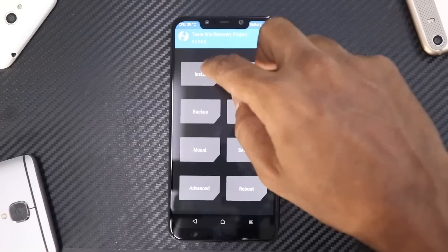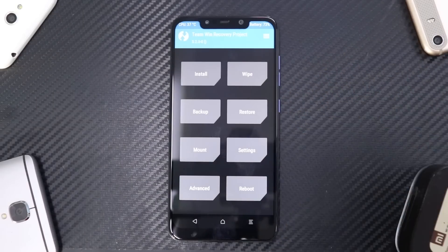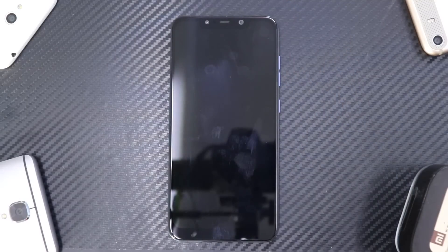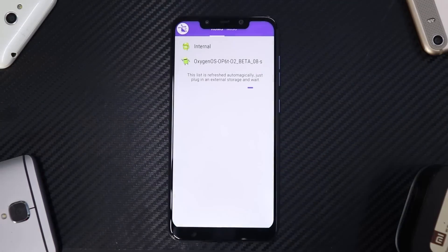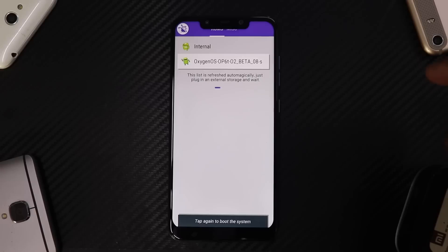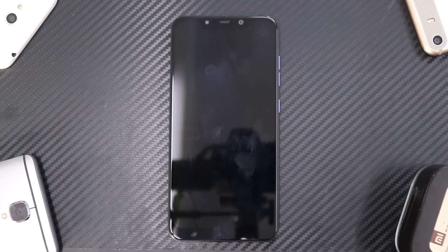This is the recovery, and this is the multi-ROM zip that you would ideally flash — and here are the two ROMs. Let me show you the boot menu: go to Reboot and System, and you'll notice it gives you a different boot menu asking which ROM you want to boot into. If I had clicked Boot Now it would have gone directly to Xiaomi EU, but selecting the other option and tapping again will boot OxygenOS.